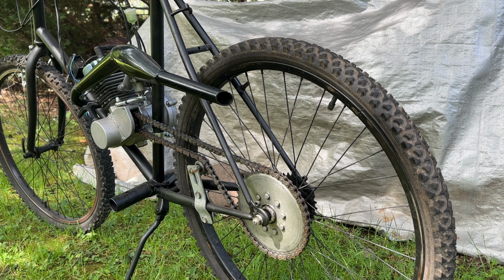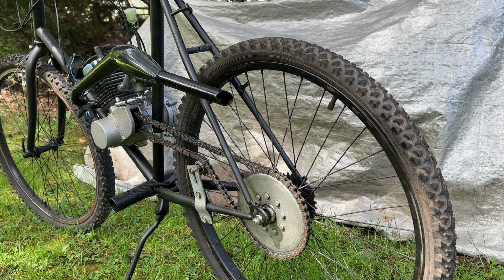But yeah, so we're just gonna oil the chain up. I might not ride in this video, we'll see what happens. But I remember last time I did have a little problem with it, something I think with the jets, because it's not going full speed. I would ride it and I would only hit like 15-20 miles. I may be a little less actually, but I used to be able to hit like 30-31 I think at one point. But that was from the other engine.